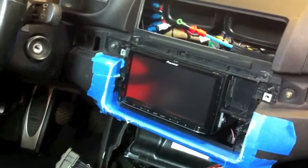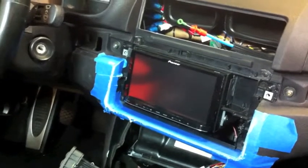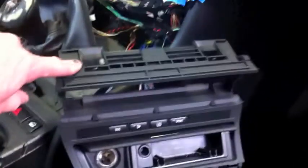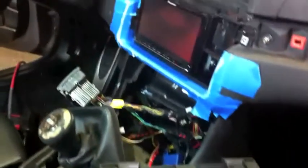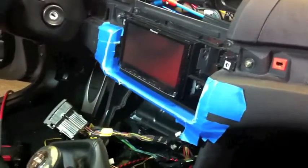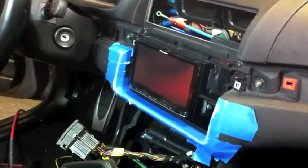These are the preliminary stages where Rick's actually molding a dash piece in to match the factory contour dash lines. The air conditioning controls, as you can see, if you purchase the lower relocation kit from BMW — I think they're about $60 — you move the air conditioning controls down from the upper dash location to the lower dash location, like there would be in the cars that have navigation. And that allows us to put a double-din navigation in here.